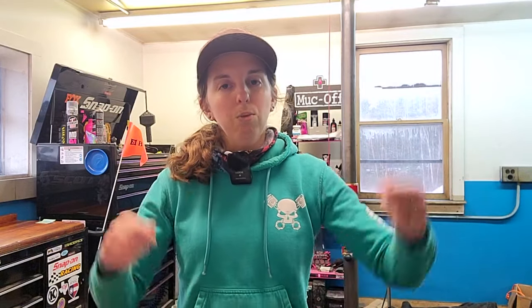What does this mean for you as a mechanic, besides making sure you get compatible stuff? Stuff swaps more than Shimano says, but is anything different about CUES in terms of installation? If you've got CUES in the stand you could probably stumble through and get it pretty close — it works relatively the same. The chain sizing is similar to what we've gotten used to with the new 12-speed, where you wrap the chain ring big to big and add links based on where you ended. That's all in their manuals and easy to figure out.